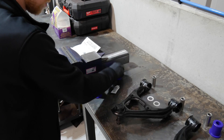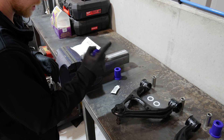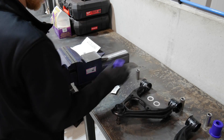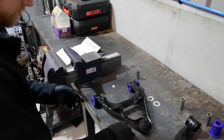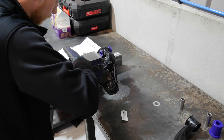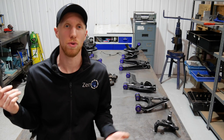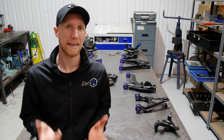We've cleaned out all the bore holes so the bushes press in easily. Per the instructions, you insert the bushes into the arms without any grease on the outside, then lube the inside of the bush and insert the metal sleeve. As you can see that wasn't too bad because we did all the prep work upfront - the bushes went in really easily using the vice. Make sure you use the PTFE lubricant they send with the bushes - it's not to help you fit them, it's to keep them lubricated long-term once fitted.